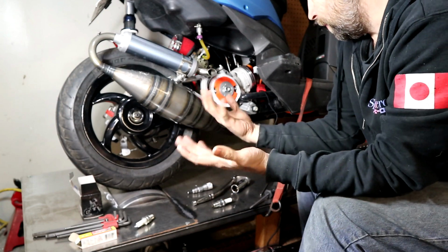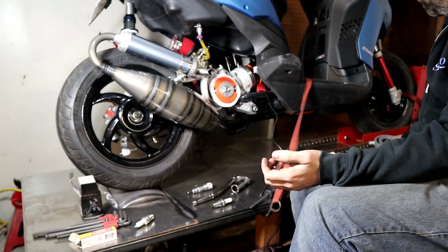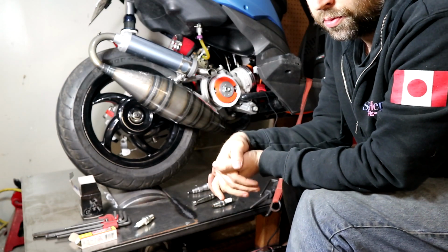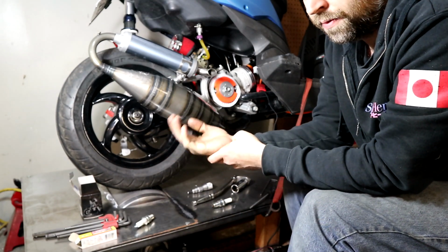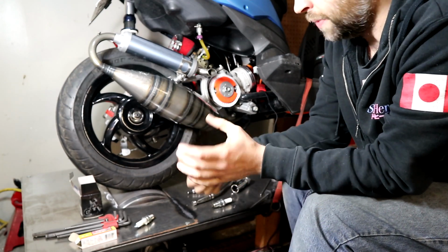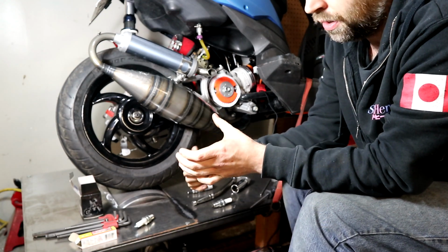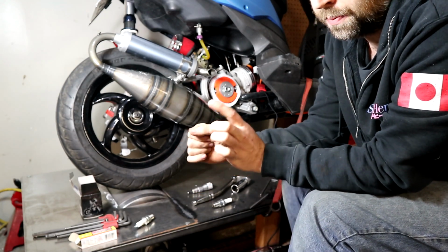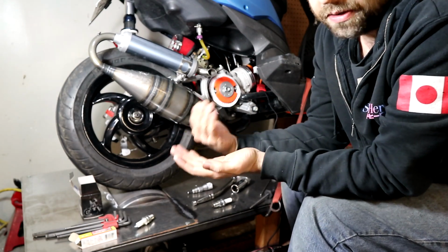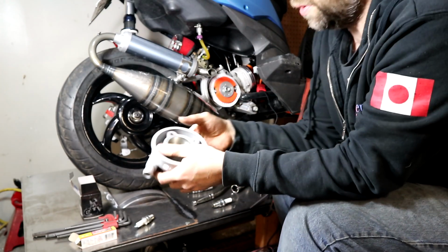So getting right into it, what is ignition timing? Well, timing is the advance or retard of spark in your motor. So as the piston is coming up, the spark event doesn't happen at the very top. It usually happens before the piston is coming up, which is known as advance timing. Confusing, but let me show you.